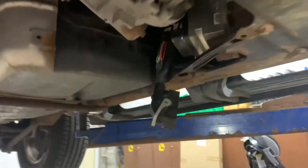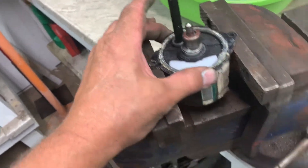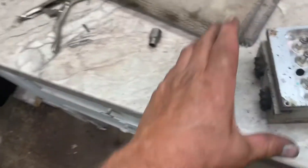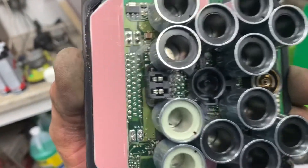I did my scanner test and couldn't get the pump to engage. I tried a different module just for the heck of it and it wasn't working, so I thought maybe the pump was bad. Here's the pump - you just apply power to both terminals, positive and negative, and the motor should work. The motor sticks through the whole unit. Take the module off and see how it goes into those two terminals right there in the center.